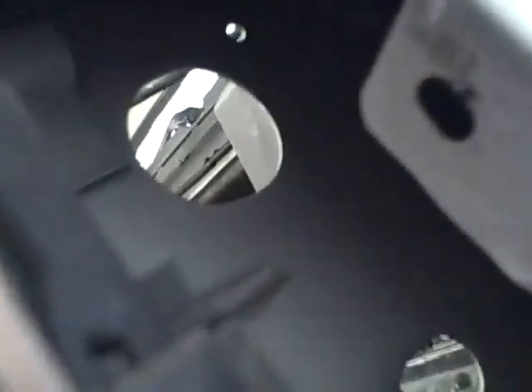You don't have to take that bolt off, just loosen it. Then give this a jerk because these clips are pulled in here real tight. You get the headlight open only that far out — and that's all the further it's gonna come, because somebody at GM designed the fender to come down over the top of the headlight, pinching it in. They warn you to be careful about scratching the chrome on the bumpers. At this point, if I tilt this over to the side and go in, I can unclip the headlight and get my connector.